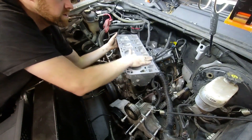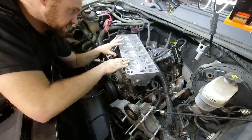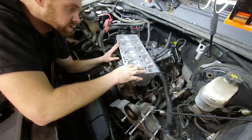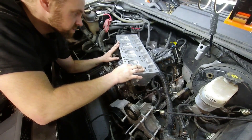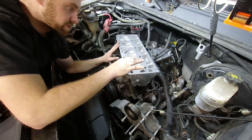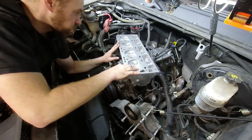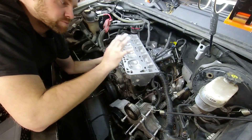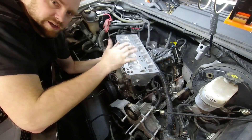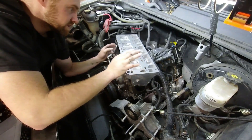You can see I got a head here — it's freshly machined. Whenever you pull these heads off, it's an absolute must to get them not only surfaced, but the valves have to be ground. I can see the margins got a little bit thin. The machinist told me the margins still had some left, but the intake valves got a lot of machining — they were very badly warped. That is extremely common on GMs, even brand new ones. You get valves brand new from the dealer and they wobble. The quality of valves they sell is just crazy.